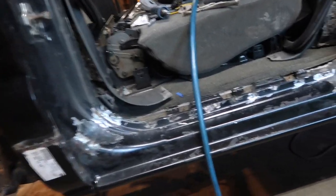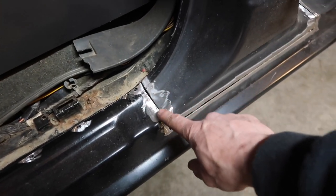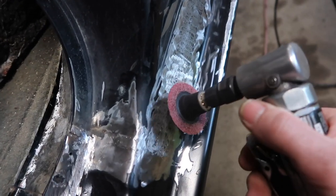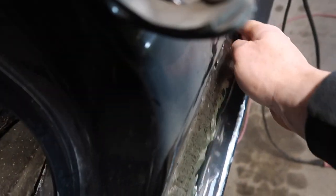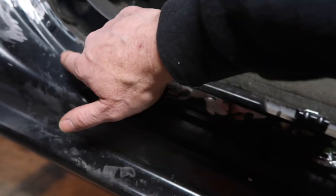At this point in the process I just went ahead and laid a bead down all the way around where that hole was cut. Here's the other side — we haven't done these yet, but I laid the bead down completely around for this side. Once we have that completely done we can start smoothing and leveling this stuff out. Next I'm going to whiz wheel this stuff — smooth it all out to where when you run your hand down here it's going to be nice and smooth and level. I went ahead and just hit all the little holes where the spot welds were, filling them in with weld.